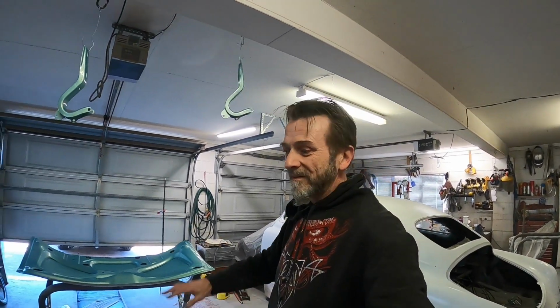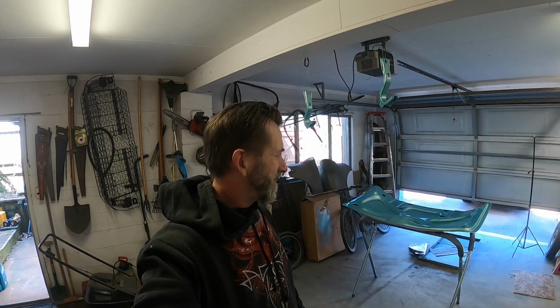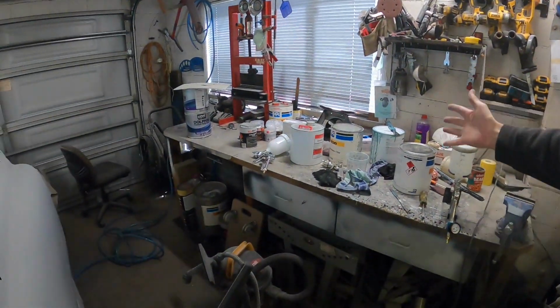Well, we'll let that settle down. It might flow out a little bit. There's enough bloody paint on there. Went through a ton of material as well, way more than I should have, trying to get some clear on the inside of a boot lid. Probably used a good litre of clear, which is way too much, but you're not even going to see it anyway. I don't know why I'm stressing about it so much, but I just wanted it to go a bit better than that. I might need to have a little lie down after all of that, but I've got this carnage to clean up now as well, so I'll get onto that and might chuck that out in the sun.